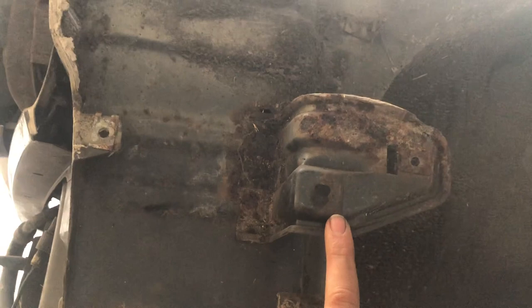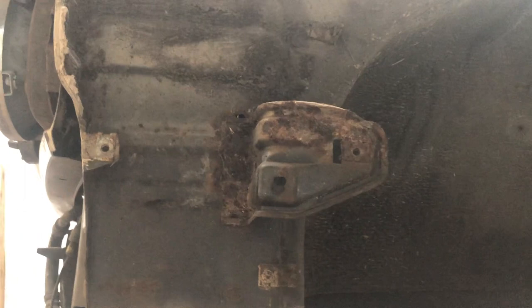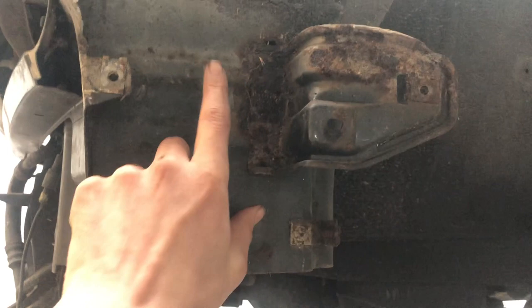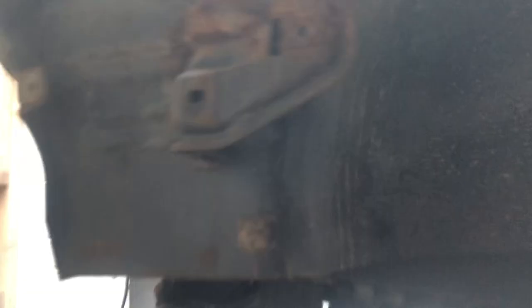The other thing to add is M535i-specific: they have slightly different bumper mounts that are spot welded on from the factory. You will find some cars that have had them bolted on — those tend to be cars where the body kit was a dealer option. You can see there's a little hole above the bumper mount. This one is actually pretty good compared to what we're used to seeing — normally they're rotted out all the way around here. Have a good look; you can see it from underneath. If the bumper has all its inner plastic trims you'll struggle to see it, but 90% of the time if the bumper mount is rusted it will have come through to the wing — M535i wings tend to rust along this section pretty badly.